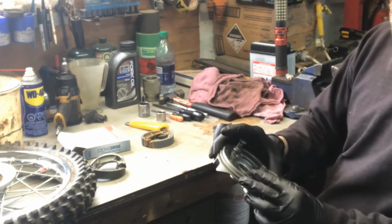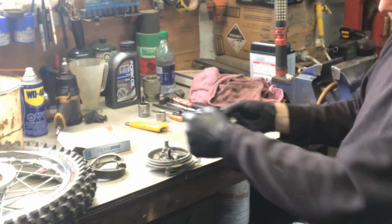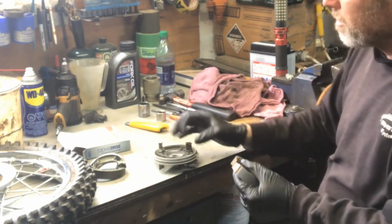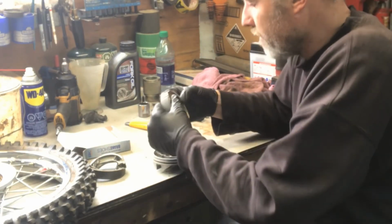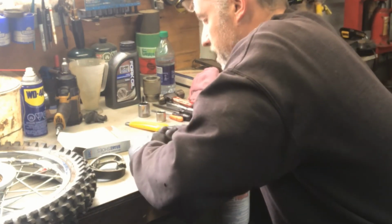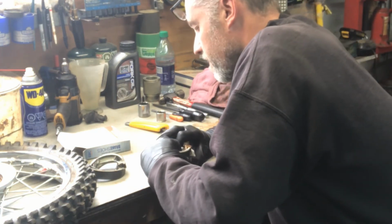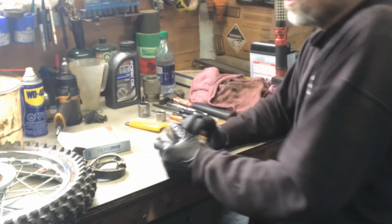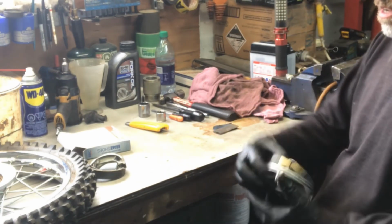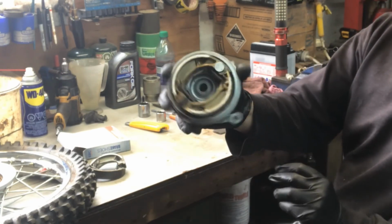So that's all good. Now that we got new pads and new springs, just make sure that you put the flat with the flat, because some people make mistakes and put them in reverse. I've seen that in the past. So you basically have to separate them. There's one there. There, make sure you don't pinch your fingers, because that feels real good. That's happened to me in the past. So, new shoes are on.